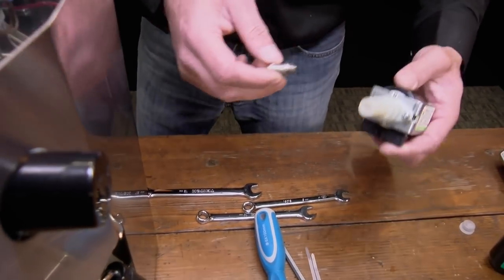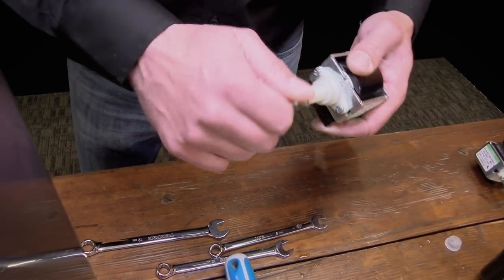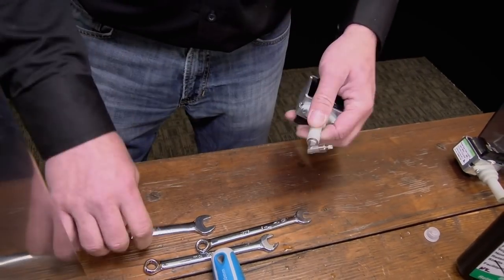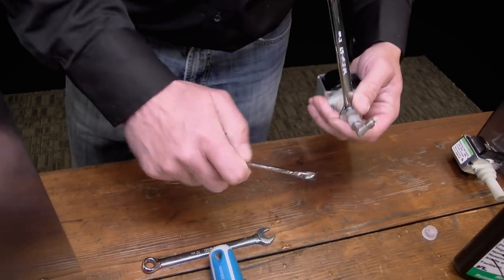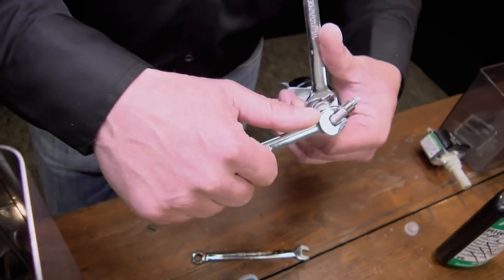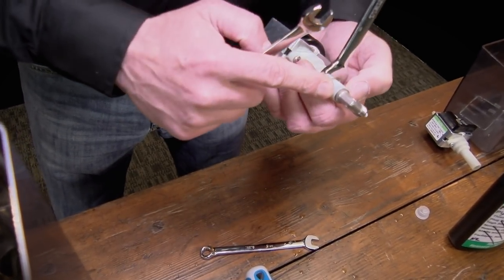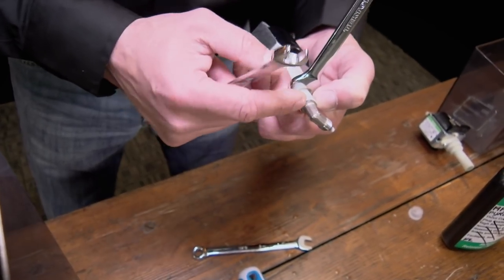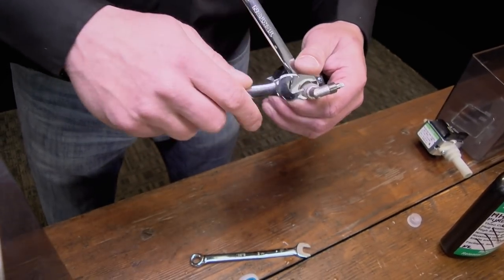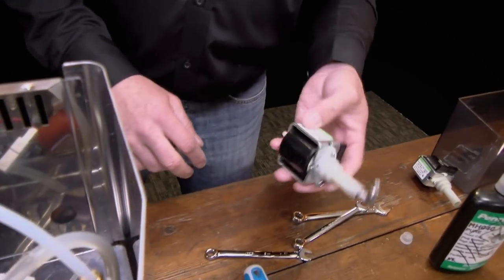I always like to put a little sealant on it anyway to add extra benefit to the seal. Now you go as tight as you can with your finger, then put the 12 millimeter wrench on and grab one of your smaller wrenches, hold the wrench and put the other wrench on the elbow and give it a little snug. You don't want to go too much because you're going to start compressing the neck with the collar on the elbow and it'll start cracking. You just need to go finger tight as much as you can and then give it a quarter turn. Now the elbow is on the new pump and we can reinstall it.